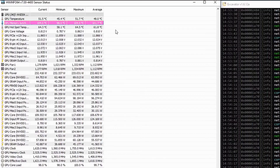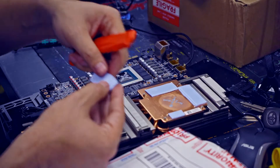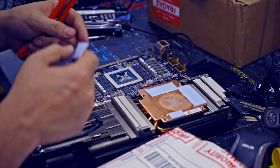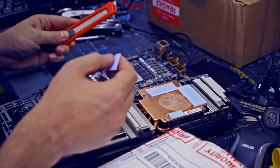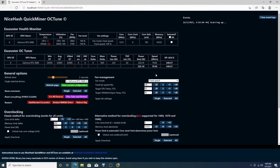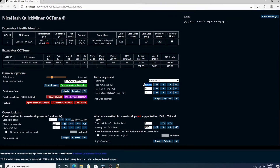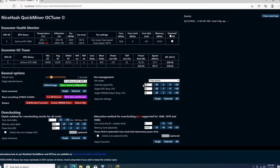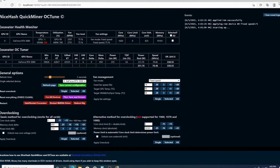We're going to go ahead and try replacing the thermal pads, as recommended by various sources across the internet. We'll be using these random Chinese thermal pads we have lying around for cooling M.2 drives — variety packs of multiple sizes. I'm going to be sort of guessing with these. You can see here that I did a terrible job at guessing the width required to make full comfortable contact with either the backplate or the memory chips themselves, and our card is performing worse than stock.